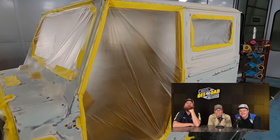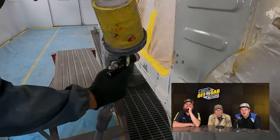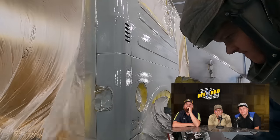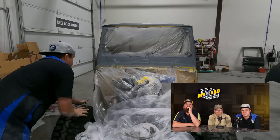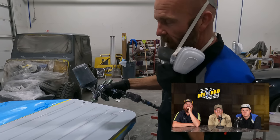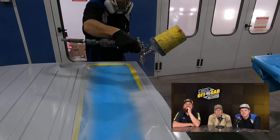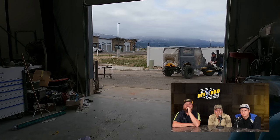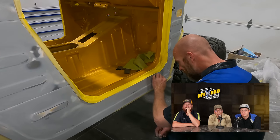At least that pushes around easy — it's so light, so little. We're going to wax and grease it, blow tack and static it, and then we're polyester priming it. So we're going to get the polyester put on now. We're all polyester — we've got it guide coated. Right now we're laying down etch on the bare metal spots first before we hit it with the regular primer.